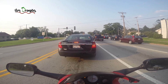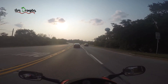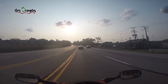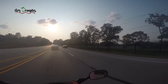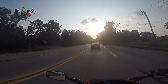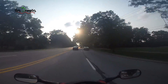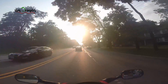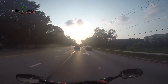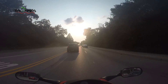I've ridden this bike over 2,000 miles since I've had it. The chain came loose and the reason I believe — first of all it was an old chain, and second it was a rookie mistake: I power washed some of the parts on the bike because they were just ugly with a lot of gunk on them, and then I forgot to put chain lube on the chain.